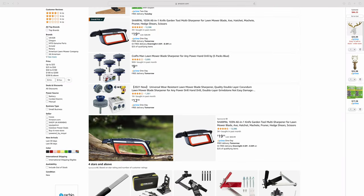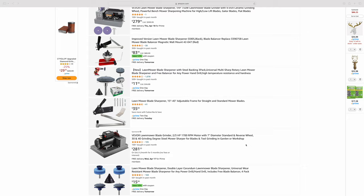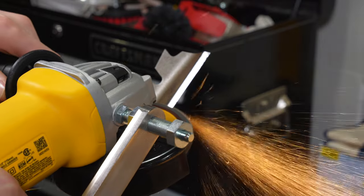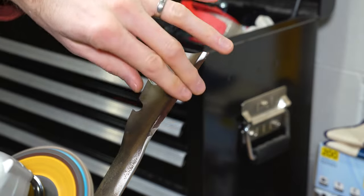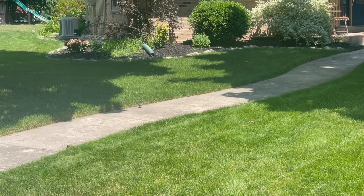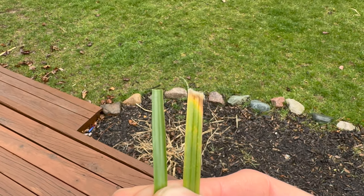There are many other devices on the market for sharpening blades, but often they will not work as well, so I am not recommending them — but if I'm missing something that works really well, please put it in the comments below. As for sharpening frequency, it really depends on the number of blades your mower has, the size of your yard, mowing frequency, and whether you hit a lot of sticks or stones. Generally, I sharpen at the start of every season and one more time midway through the summer. If you notice a brown cast of grass blade tips across your lawn a few days after cutting, or jagged edges on freshly cut grass, you are likely past due on sharpening your blades.